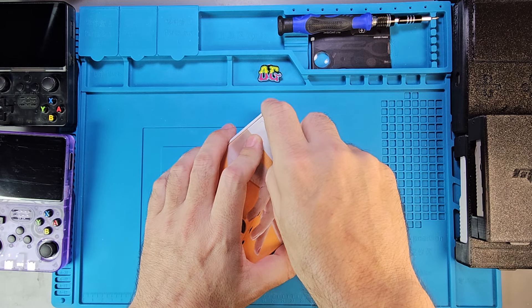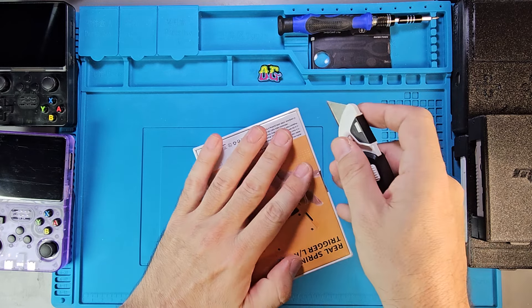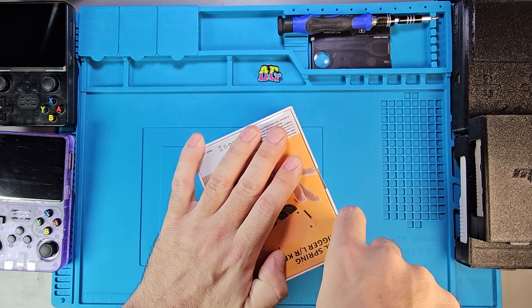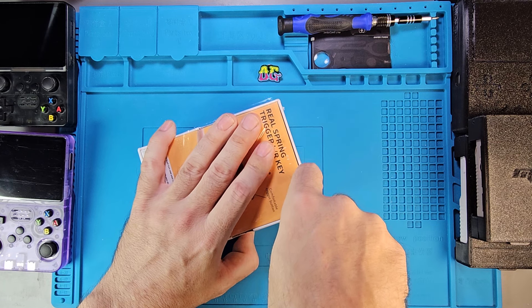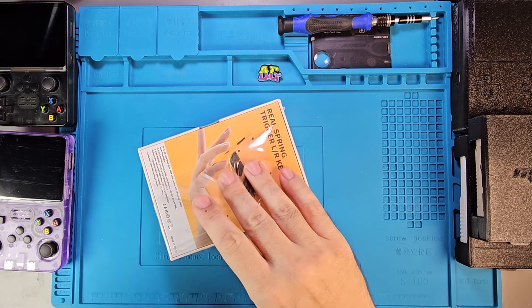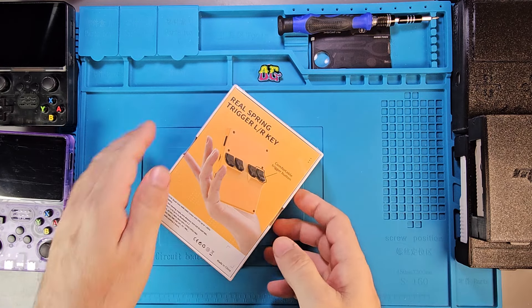That's something that usually needs to be done on these devices. For those of us who prefer controls to feel the best they can, it's an easy fix — just open up the back and loosen those two screws, one behind the D-pad and one behind the face buttons, and they will feel a lot better. There are a couple other things you can do to improve that, but that's for another video.